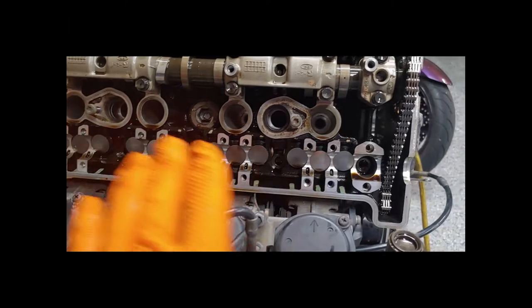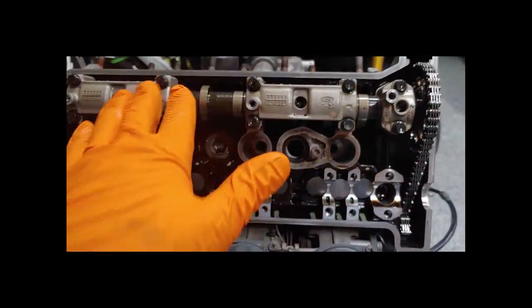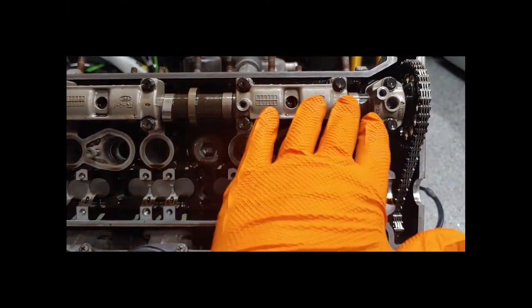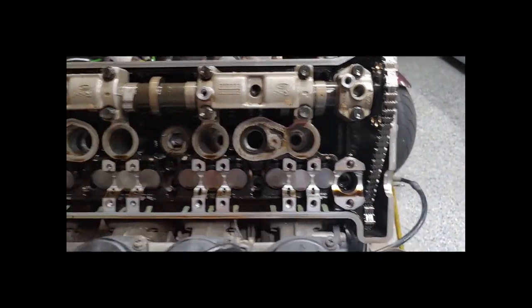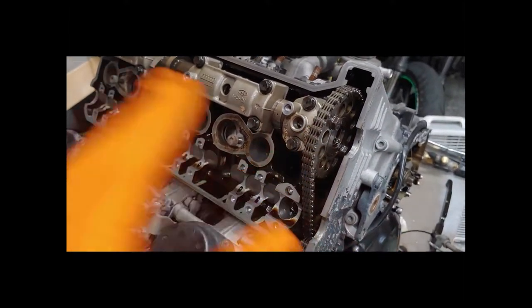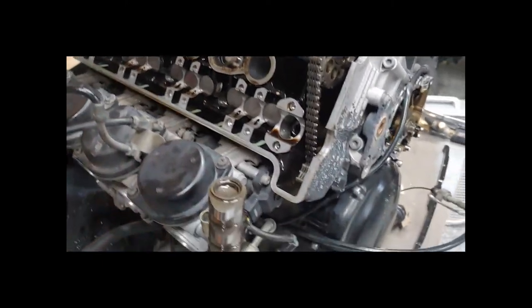Once you have your buckets all back in place — I only had to do one side, but if you had problems with the exhaust side you'd have that side off as well. For me, because I didn't have to take it off, I just had to loosen these so I could move the cam around. Let me show you what we're going to do from here on reassembly.